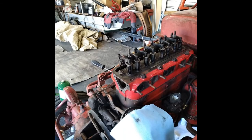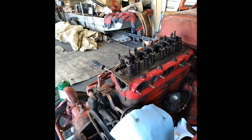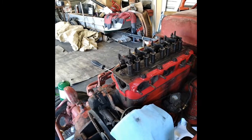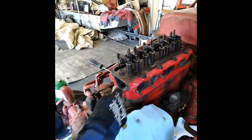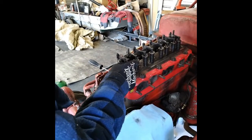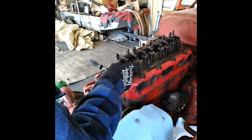When you're adjusting these pushrods, you're going to set them at 14 thousandths. Bring your feeler gauge up to where it needs to be — this is a 14 right here. You want just a slight amount of drag in there.